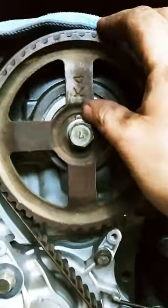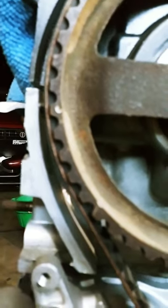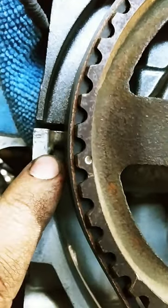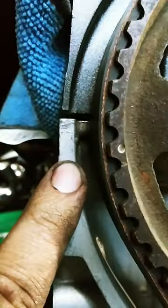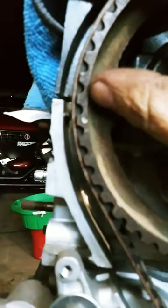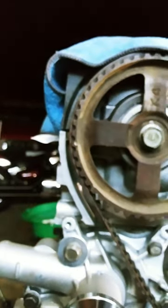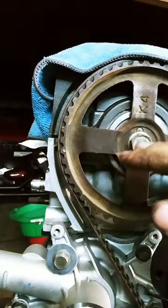On the cam, usually this key is going to be facing up — sometimes they're offset depending on the year or if it came off a different engine. What you want to look for is this notch here; sometimes they're painted, sometimes they're not, you just have to look for it. It will have an indention in it, and you want it to match up with this notch inside the head. This one is slightly off — this head's been shaved down too many times and needs re-welding, but it'll still run. You want this as close to that notch as possible.